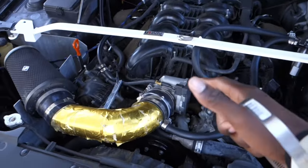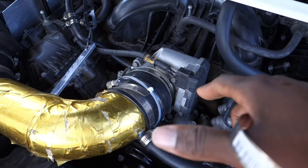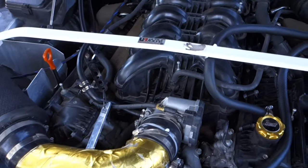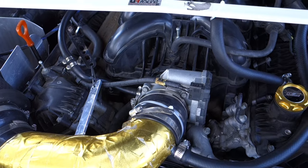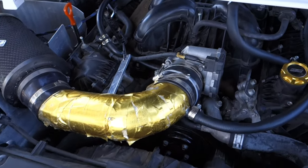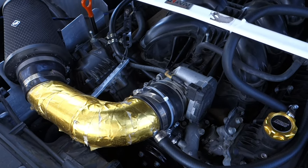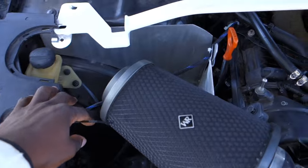The second mod is this 85-millimeter throttle body. The stock throttle body on this car is 82 millimeters. I purchased a second used throttle body, had it sent to a machine shop, and they ported it to 85 millimeters. So far it's been performing really well — the car feels like it breathes better, acceleration feels much smoother, and jumping on the gas from a stop the pull is noticeably greater. I highly recommend an 85mm throttle body, and I haven't had any codes or engine issues.